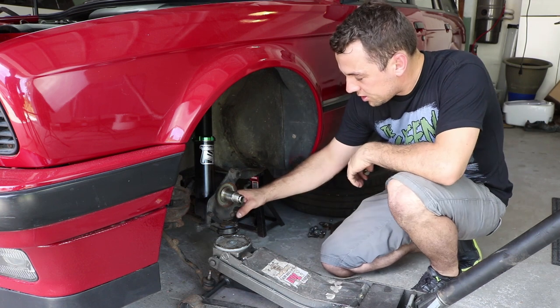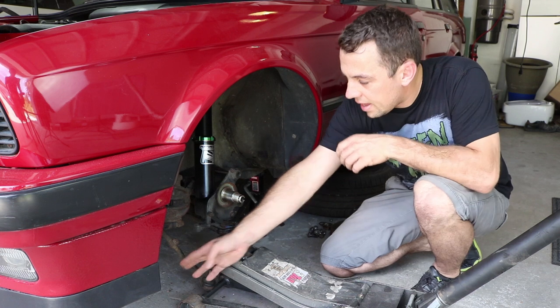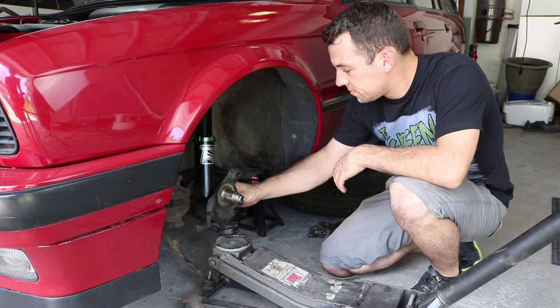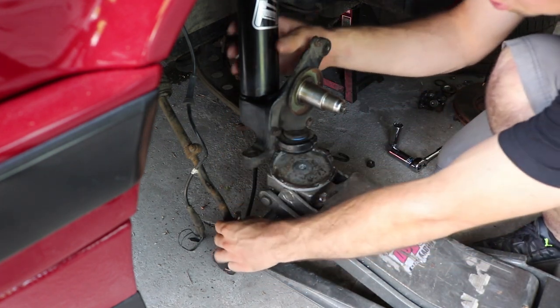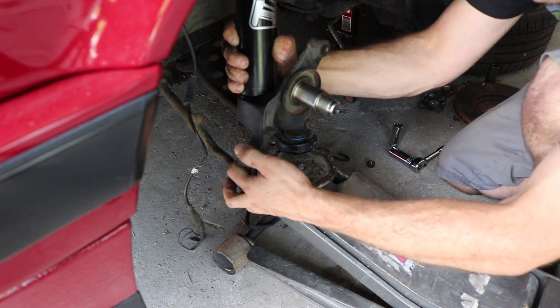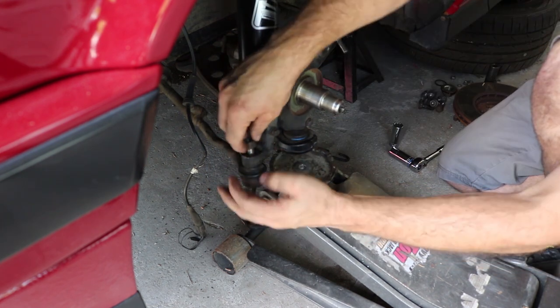And then, as a reminder, the control arm is a 19 millimeter nut and the steering end link is a 17 millimeter nut. And then of course, make sure that you always torque your nuts and bolts to spec, and I always have all the torque specs in the description of the video.